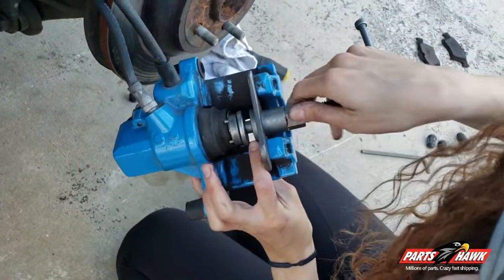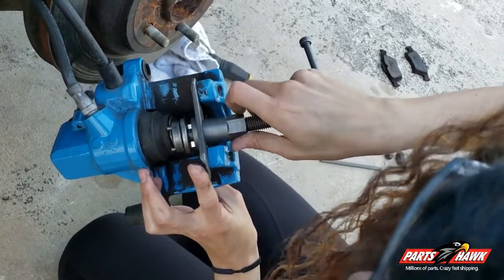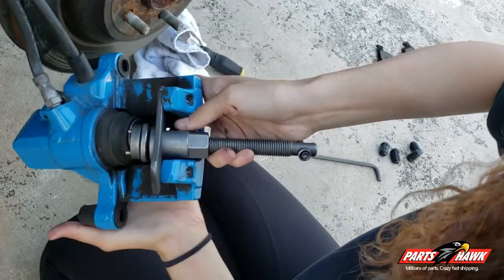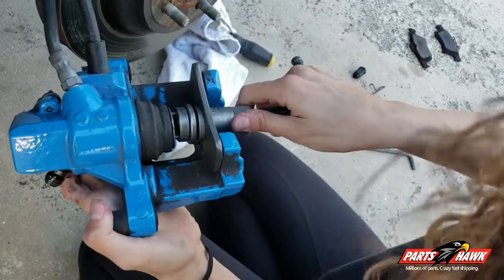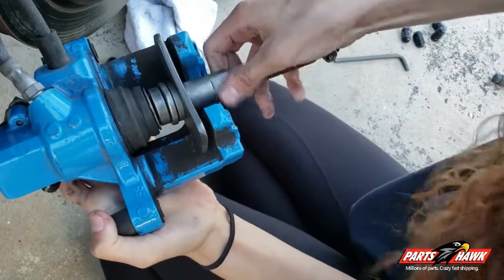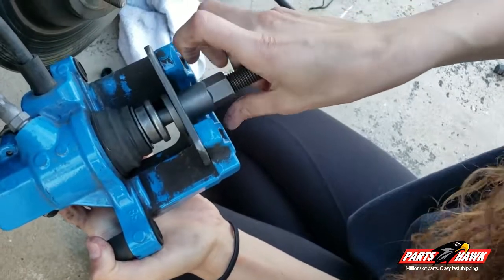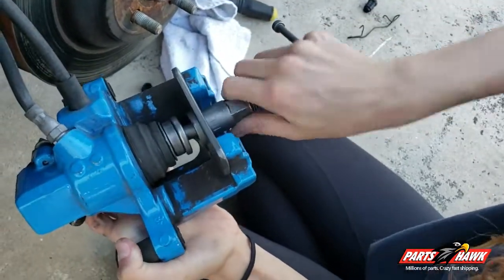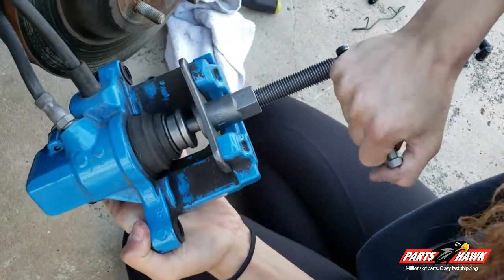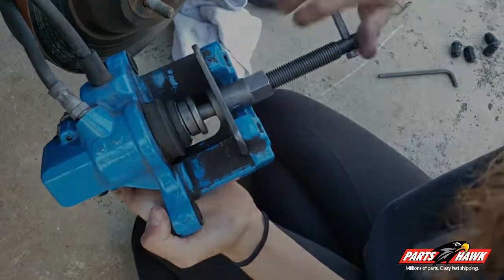Once the caliper is removed, we're going to take our caliper wind back toolkit, which is also going to be linked in the description. In our case, it was the size A tool bit that we used. You're going to simply place that onto the caliper. Make sure that you line up the two pins that it has with the two pins located in the piston. You're simply going to attach that there, give it some tension, and then crank that so that the piston can compress.